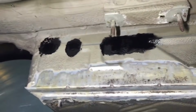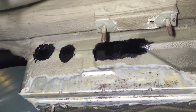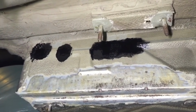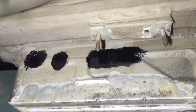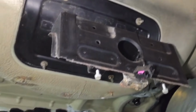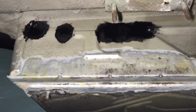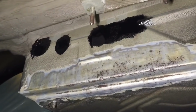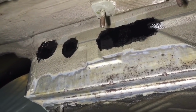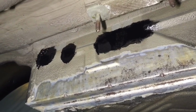The only reason they're on there is because of non-M3 models, so like 316 to 330s, their carbon canister for the fuel expansion neutralizing parts sits up there, whereas on an M3 it sits here, on a non-M3 it sits here. And it's useless. There's no point being on a car whatsoever. It's just a corrosion trap, and we see battery trays that have corroded out, so we take those brackets off and make sure that corrosion does not set in those points.